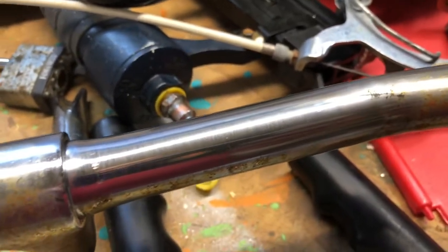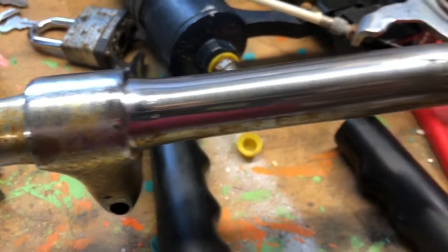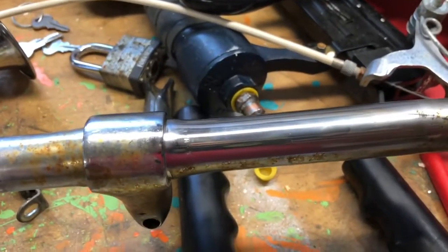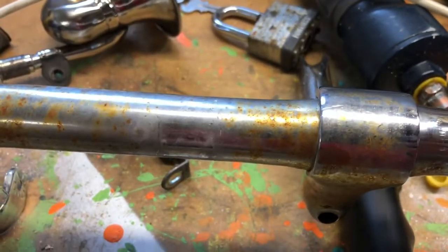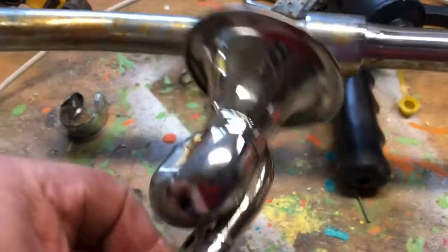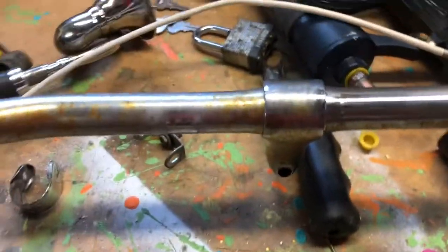If I put it on the wheel and give it a good polish, the rust comes off pretty good. It's not gonna be perfect because it's pretty banged up, but what you can do is after you polish it, you can put a coat of chrome polish on there - the waxy stuff - and it'll keep the chrome from spotting up with rust again. Don't leave it outside, which I did for like two years. You can see things like this horn here - you can polish them up on the wheel and get them looking new again.